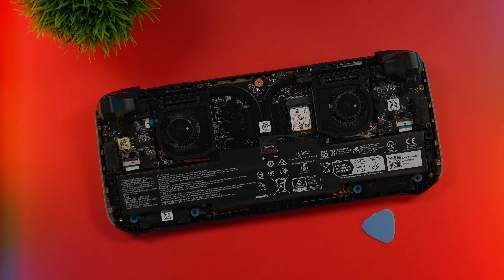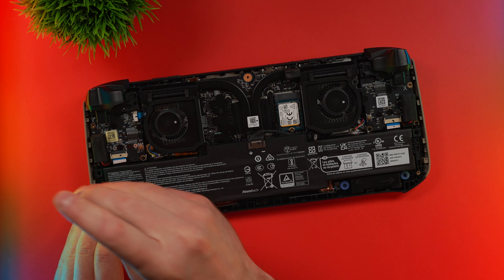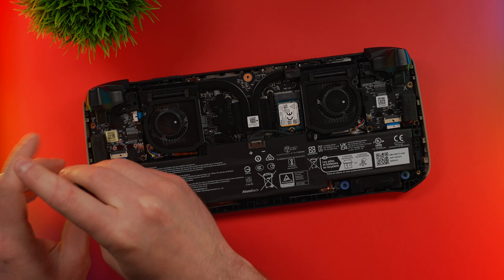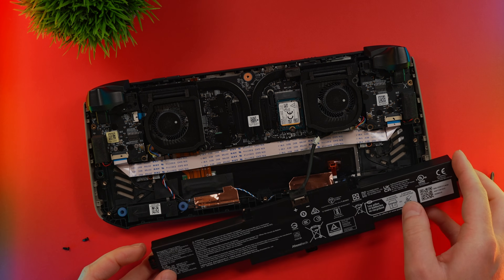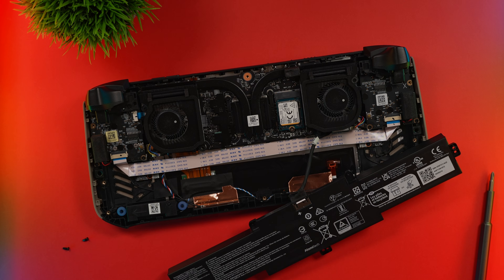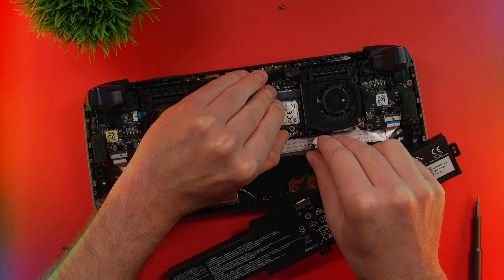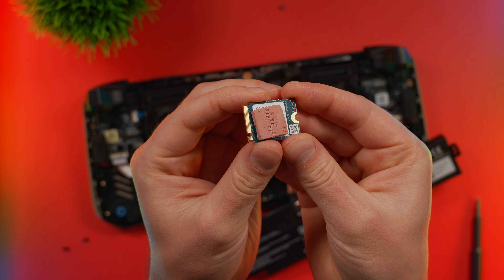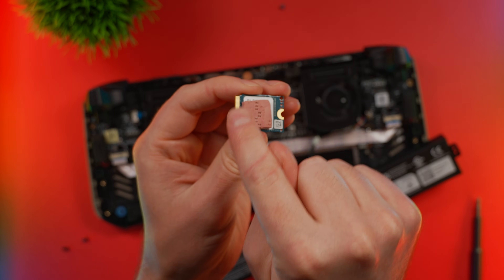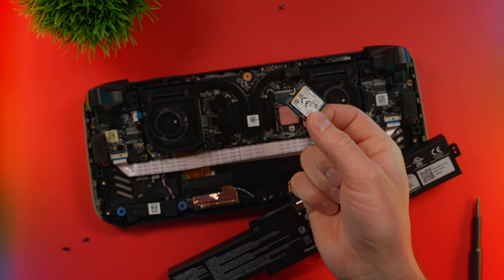Don't forget the clips on the top. The nice thing about the Claw is there's no cables attached to the back. The SSD we're replacing is right here, but unfortunately it sits very close to the battery. On the battery there are four screws that hold it into place. Just be really careful going very close to a battery with a metal screwdriver — you don't want to slip and accidentally puncture the battery. It's nice how easy MSI made it to swap out the battery; it comes right out with those four screws removed. To keep this even simpler, I'm not even going to disconnect the battery cable — I've never had an issue with leaving it plugged in. Remove the one screw holding the SSD in place and keep that one separate because it's a different type of screw. Then just lift up the SSD and kind of wiggle it backwards — it should slide right out. The thing I don't like is there's some sort of thermal putty underneath the SSD. While it's good at transferring heat, you don't want it on the pins of your SSD. This is designed to wick away heat from the SSD into the motherboard. I'm going to put it back though, just in case.